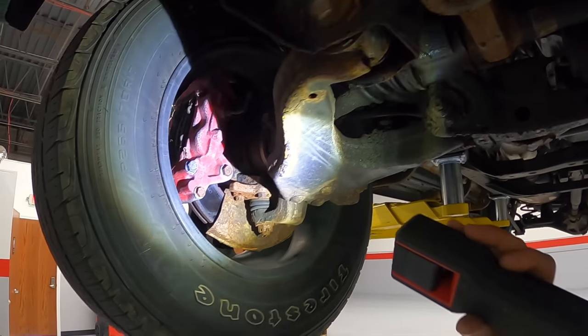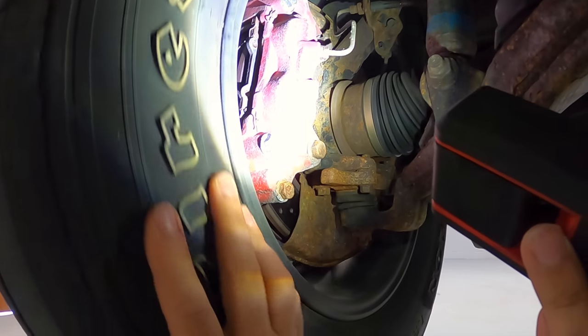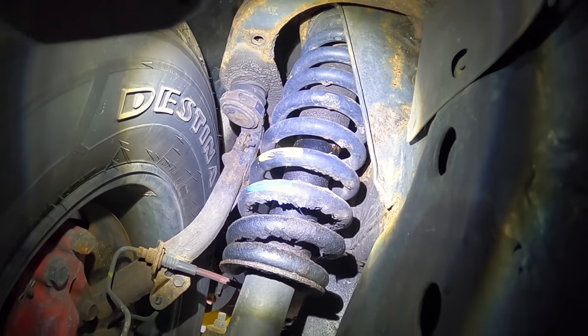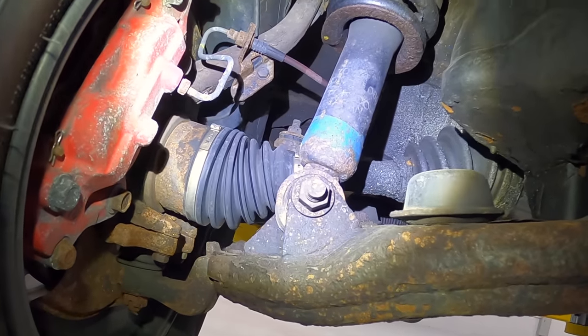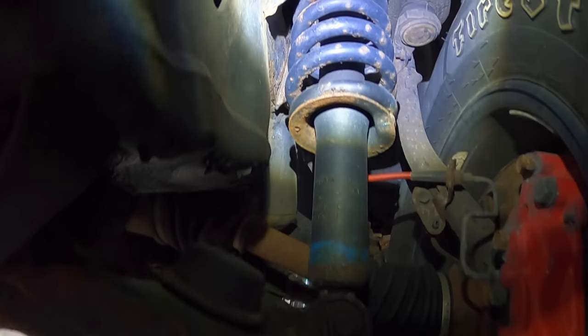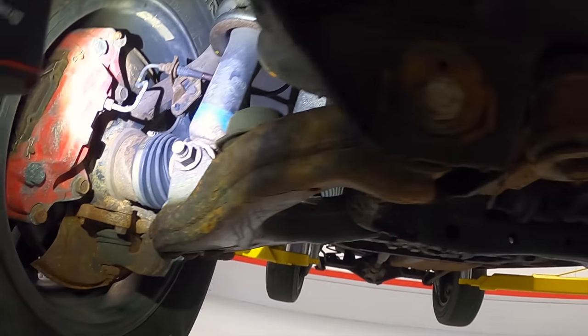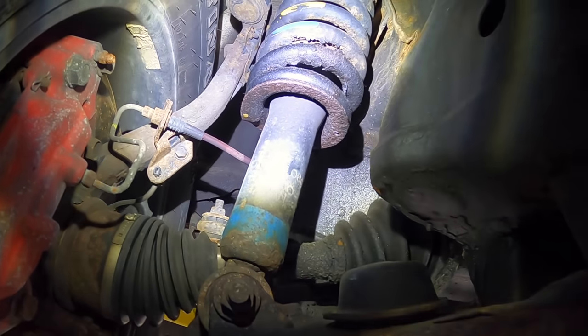Moving on to the brakes — the customer has some painted red calipers. We've got plenty of pad life left. Always spin the wheels on these because the calipers are notorious to seize. Then we look at the strut, and this strut is leaking — it looks like an original one. This one is leaking, so we're going to recommend replacement. Usually when you replace one strut, we replace the other. The other side has a very slight seepage at the top — normally I wouldn't recommend it, but this one has a leak all the way down to the mount.